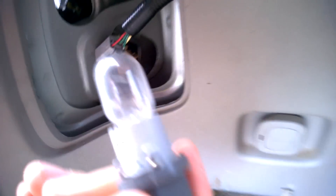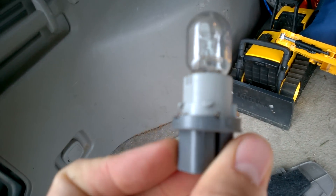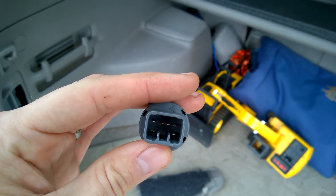I don't think it's the actual connector — I think it's the socket. So you pull that out, give it a twist, and take a look at it. These fingers need to make contact with all of those contacts in there. They don't look dirty — I kind of wish I had some dielectric grease to put in there — but what happens over time is they can get bent down a little bit. There's a fix online that says you just bend these tabs up a tiny bit and they work.